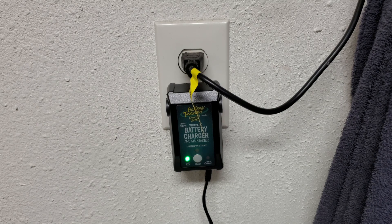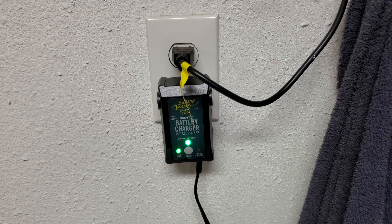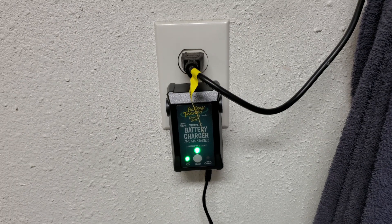When I go to start the bike in the fall, it'll be a fully charged battery and I won't have any issues. For tools, you need a 4mm hex wrench and a 10mm combination wrench — the 4mm hex wrench to remove the side cover and get access to the battery, and the 10mm combination wrench to remove the cables from the battery terminals. If you choose to use a tie wrap, then you need a tie wrap. Thanks for watching. I've got a few more accessories to add to the bike and I hope you come back and join me next time. Thanks again.